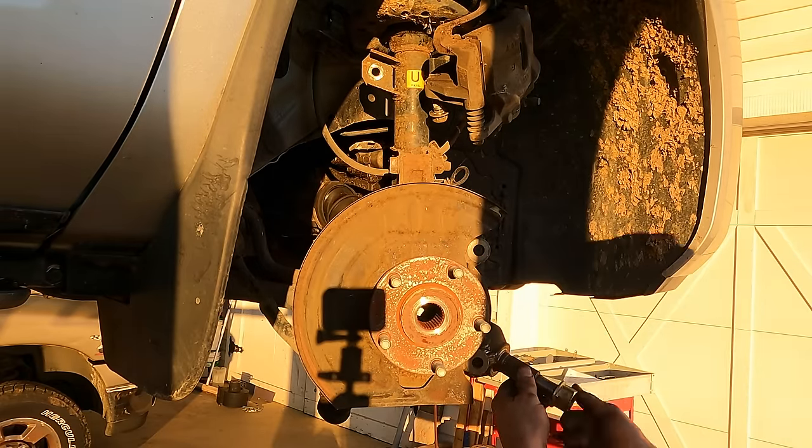Okay, this is the engine mount. So there's a support beam under here that's part of the body. And this bracket comes up off of that, and the engine is hanging here. There's a little bushing there that allows it to flex. So that's what's supporting the engine.